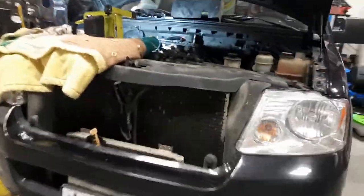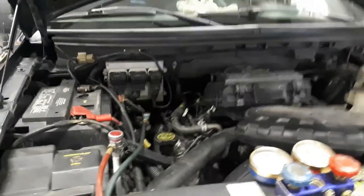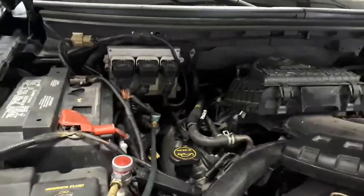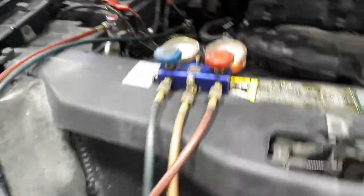Back to the F-150. We're back with the one-fifty and as you can see, I got everything all back in place - ignition wiring, all those things. Valve cover is back on there with the new VVT solenoid and everything's back in place. The only thing we have left to do is pressure test, evacuate, and charge the air conditioning unit.